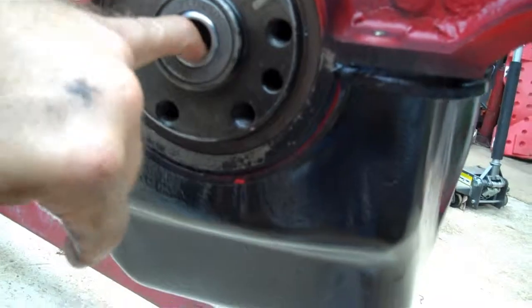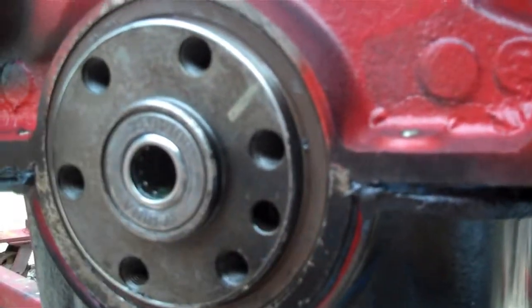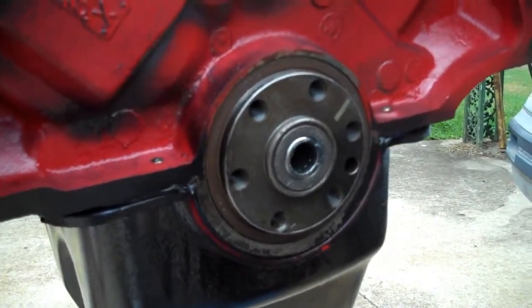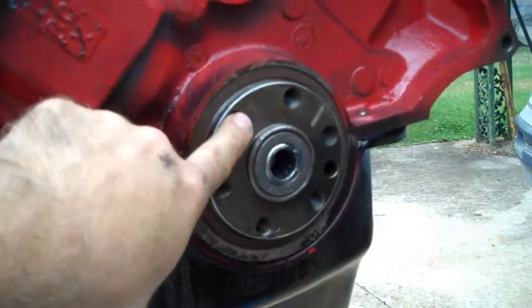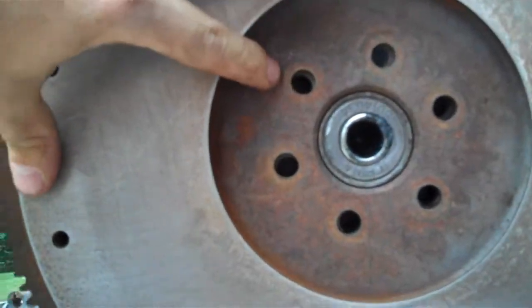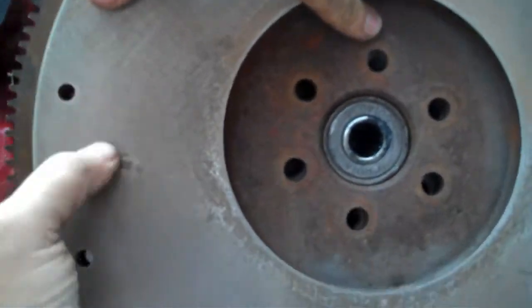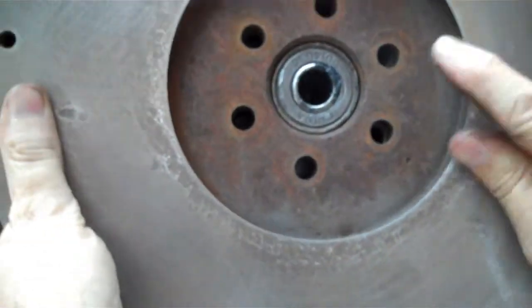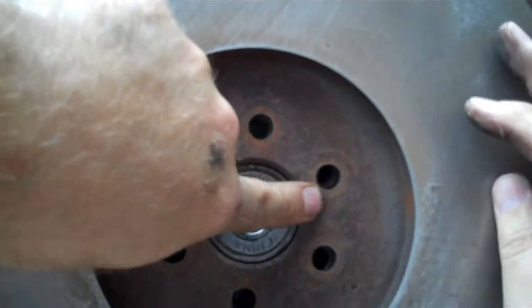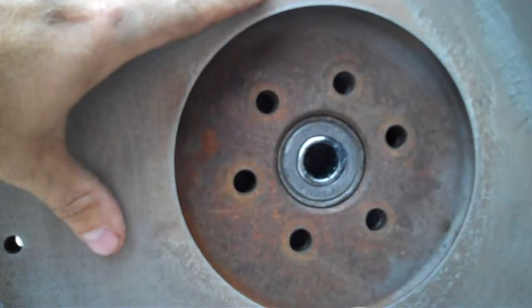The bearing is in, everything's rotating good, and it's already packed with grease. Now we're gonna set the flywheel. These 302 blocks — the holes are certain spacings so your flywheel actually goes on a certain way. Get it set up in line, see the holes. You'll find some holes are lined up and some are way out of whack. Just keep rotating the flywheel until all six holes are lined up, then stitch the bolts in.